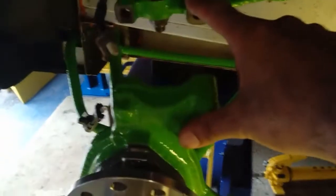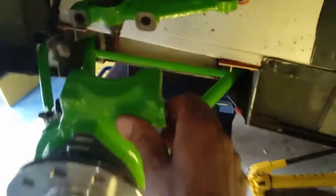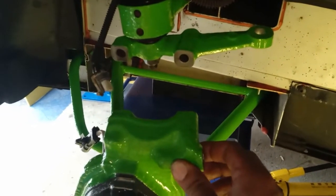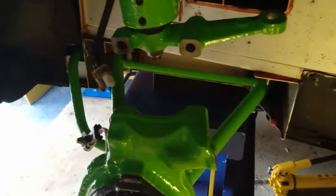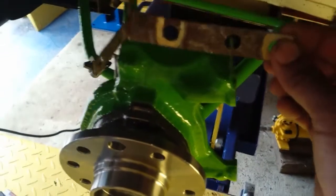The next step is to put the new hub carrier bolts in. You need to use new ones — people say it's a service item because they can snap and break, which can be quite catastrophic. Change them regularly, especially if you track your car. Apparently moisture gets in and causes the bolts to become brittle and rust. These are the shims, and one shim also holds the ABS wire.